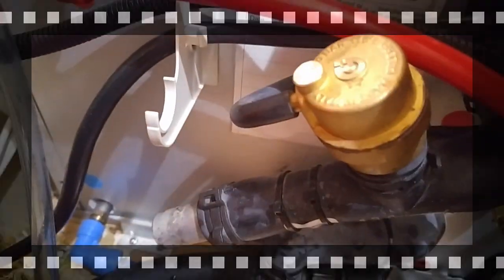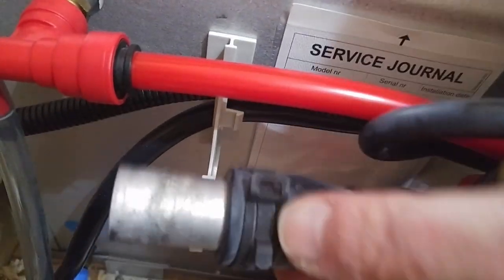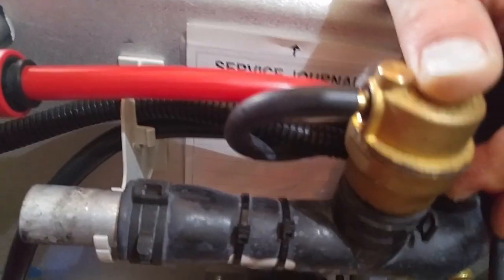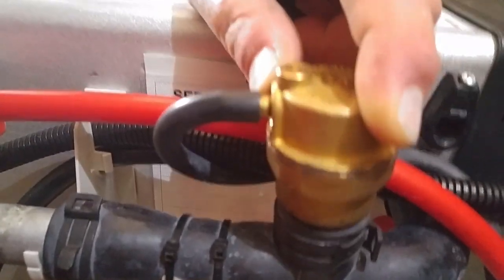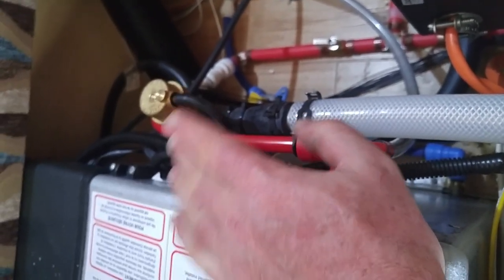And that's the moment of truth. See the angle that it was put on — look at this. See? That goes right up where it's supposed to be. That's how that valve is supposed to be mounted. Really, really nice. That will make this automatic air bleeder work right, because the float will be able to work properly in there. Now we're going to go ahead and run our new hose. There's my new hose — it runs straight across. That air bleed will be at the highest point. It won't be swooping down like it was.